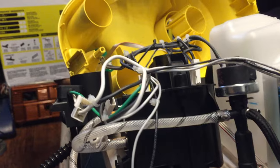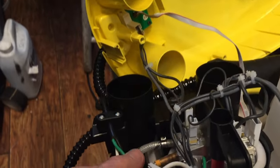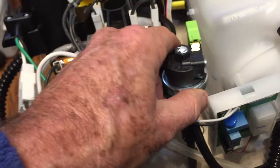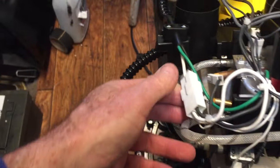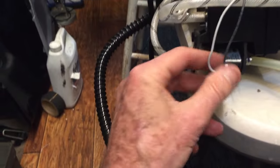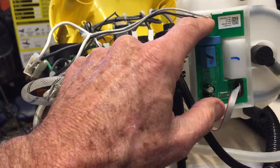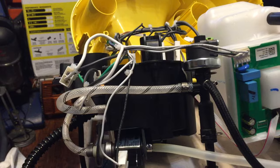For some reason the solenoid wasn't getting a signal from the microprocessor and relays. I kept looking things over, and I looked at this pressure-actuated switch here — I think it was normally on. I just couldn't find what would cause this thing not to get an electrical signal. I thought, I hate to have to go get one of these microprocessor boards, if you can even get one.